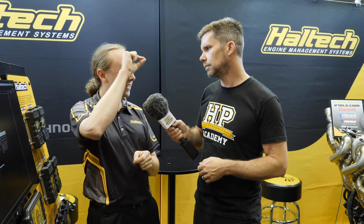I just did a test on it, looking at a throttle stab off idle on my daily, so you can see in very short time domains how quickly the throttle body moves and that sort of thing. You can see the little bumps in the MAP signal as each cylinder does its intake stroke, and also the RPM wiggles because it's a 60-2 trigger, so you can see each cylinder do its power stroke as well, and how they get smaller in amplitude as the RPM increases. So a lot of powerful stuff there for really analysing exactly what's going on with any of those inputs.